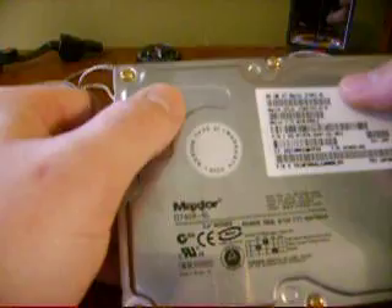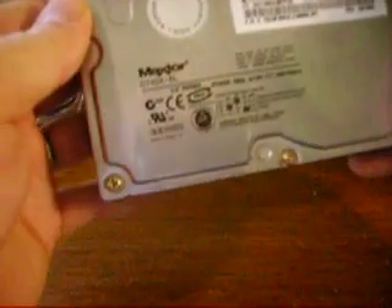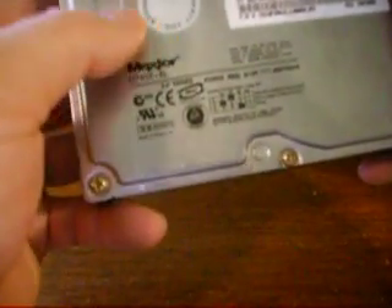This is an IDE type hard drive, but most any full-size one will work. You'll get a good strong magnet. They're fairly easy to get — a couple screws, pull the panel off, start digging in there, and you'll know the magnet when you find it because they're very strong.